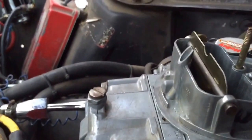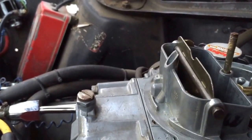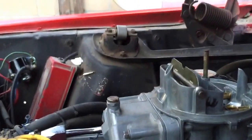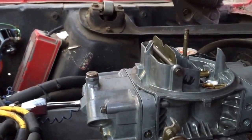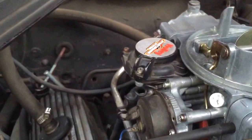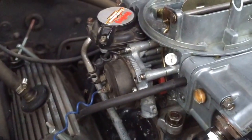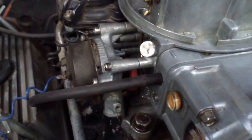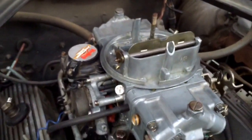You can see this thing is more open than it was a minute ago. After idling for about a minute you're getting proper airflow and you're up and running. There's also something called a fast idle cam — when you first start up you pump the gas pedal a couple times and that locks the fast idle cam, which is a little red cam on this side. It locks the primary throttle plate butterfly valves into a slightly open position, giving you a high RPM. When you hit the pedal to get started, that drops off and your fast idle cam returns to normal.